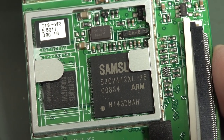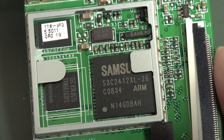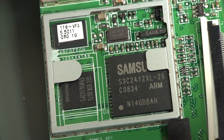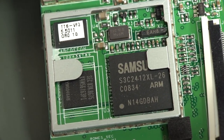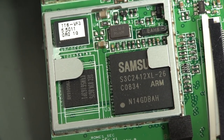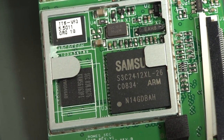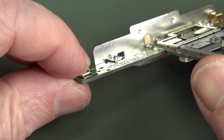Because it's near the LCD connector, there's no other driver — that's obviously got an LCD driver built in. Samsung specifically targeted and marketed these to the GPS market, and TomTom lapped it up. What also happens a lot is that large companies like TomTom can actually approach companies like Samsung and say, 'Customise a chip that's suited to our particular application — we'd like it to have this feature, or take out that feature to make it a bit lower power.' And sometimes they'll play ball if you're big enough and the quantities are there.